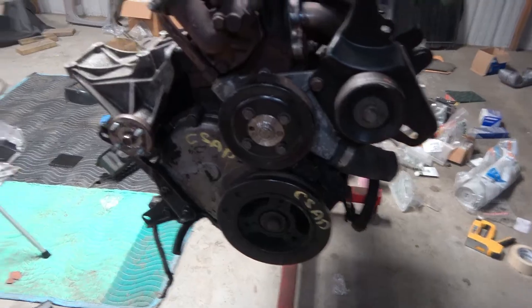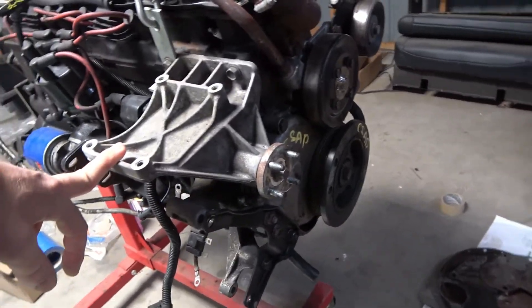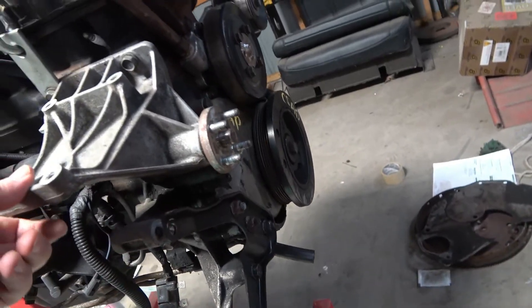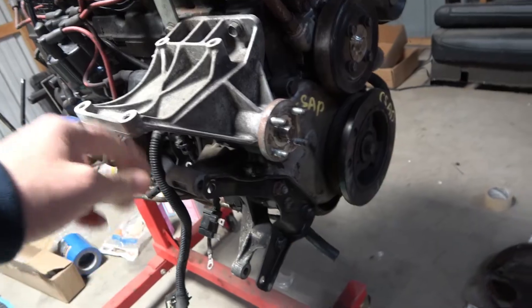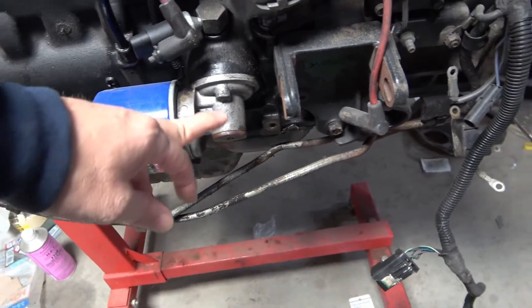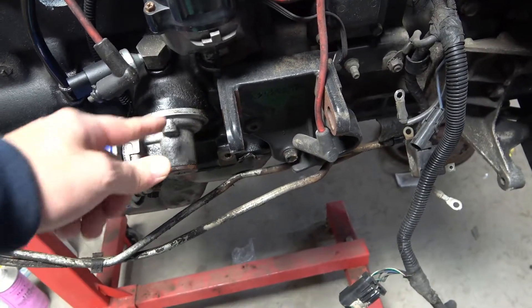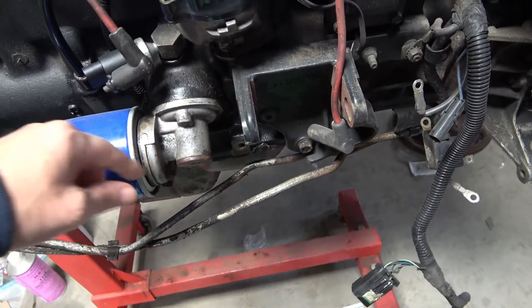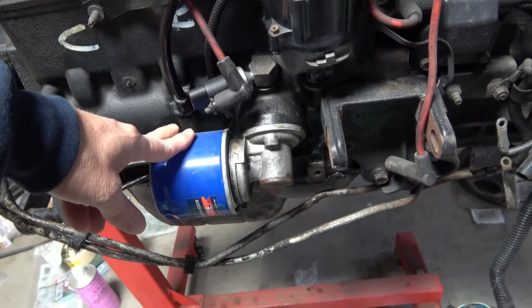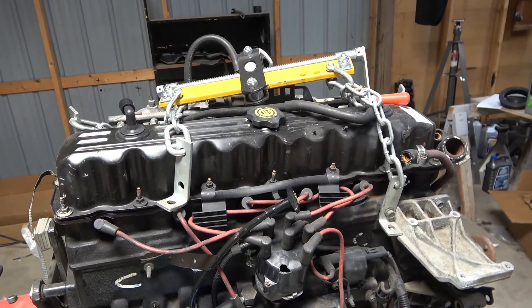Back to the engine. Some of the other things we'll swap: the AC bracket going into the CJ and the alternator bracket set will both change. We'll pull this stuff off and swap the parts out of the CJ into it to match up. I will retain the oil filter adapter set going into the CJ — while it creates a potential leak point, it allows us to run a much larger filter, and y'all know how I like large filters. So this is the motor we're going to build off of. Next video we'll start tearing it down.